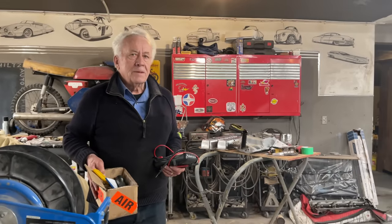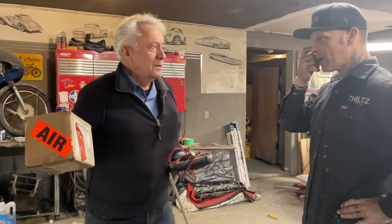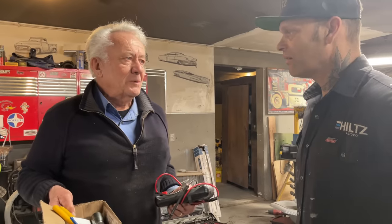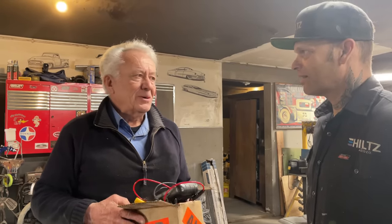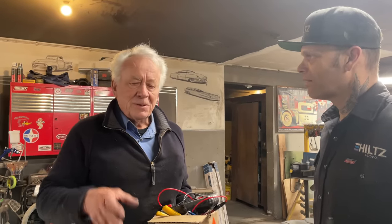Here we go, we're getting involved somehow. That engine I completely rebuilt, I put it in, and I wanted to take it to Peter's to be commissioned before I started running it. I had one fuel pump hooked in backwards, he fixed that. It started up and ran like a top, quiet as could be, for about a minute and a half. He looked at where the oil was. The oil was mixed with antifreeze, so he turns it off.